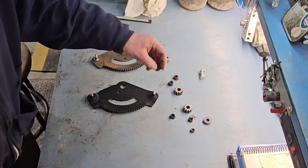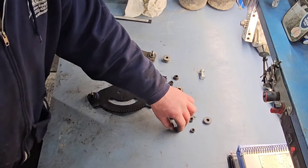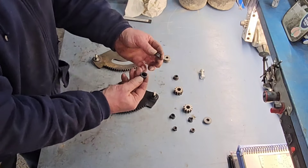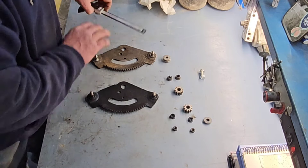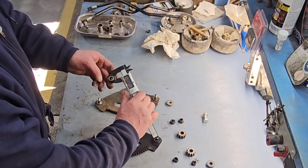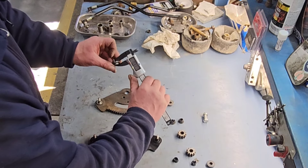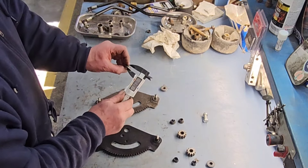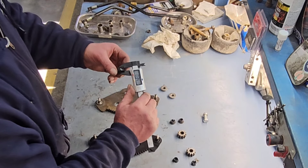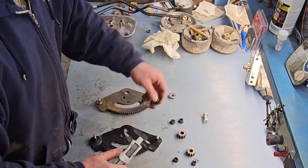We do have new nuts — they are not flange nuts, though they appear to be lock nuts. Actually, they are not lock nuts either. The original nuts are flange nuts that go right up in here and help hold this bushing in. I may reuse the old flange nuts. For the sake of measurements: the old bushing is 0.62 inches across the flange, the flat washer part is 0.09 inches, and overall height is 0.30 inches. The new one is 0.31 inches, and the flange is 0.62 inches — so the bushings are essentially the same.